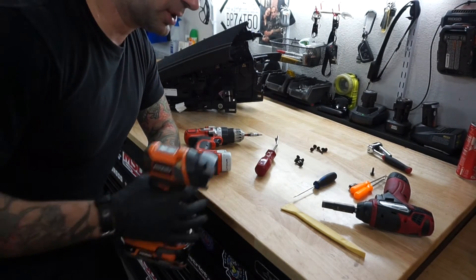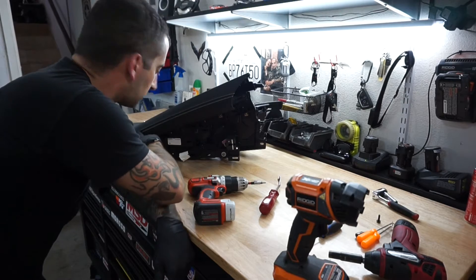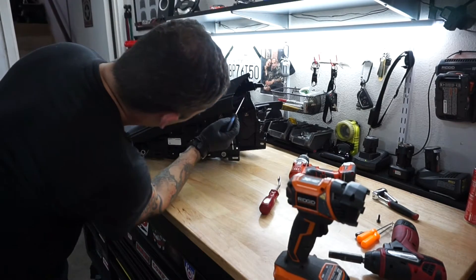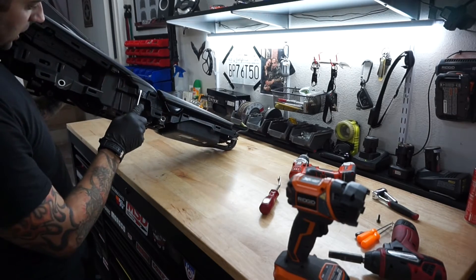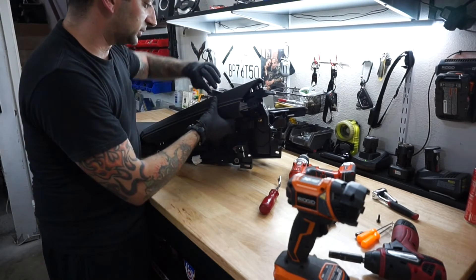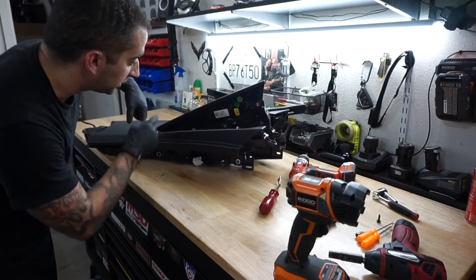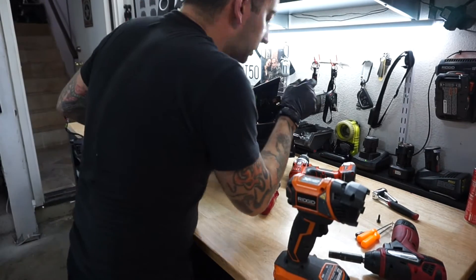Now to take this apart and get the top cup holder off, there are basically clips and screws holding it in. To get to the clips it's in your best interest to remove the HVAC controls first — it makes it easier. To get them off, there are nine T15 screws: one, two, three, four, five, six, seven, eight, and nine. You don't have to remove these to get it off, but it makes it much easier. Once you take the screws out you can wiggle it out — there's a little lip it hooks into. Then you can get to the clips much more easily: one here, one here, and two on the other side.